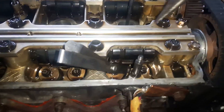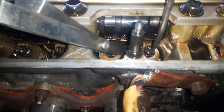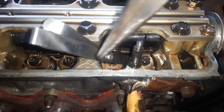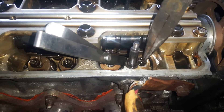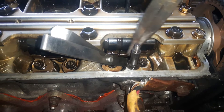I found it's actually a bit easier to use a long needle nose plier to hold that bolt instead of the flat head. Use the long needle nose plier to hold the bolt, tighten the nut slightly without moving it, and keep the feeler gauge in there. Then use the 10 millimeter socket to retighten it properly and make sure the feeler gauge is not stuck — it should still be moving snugly.